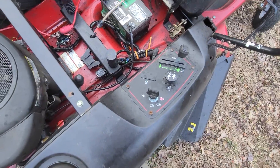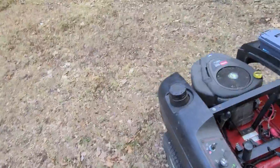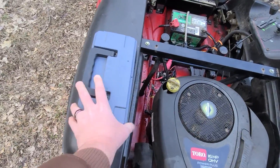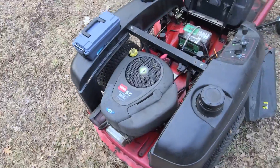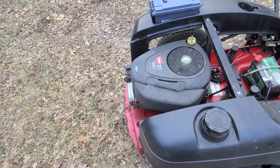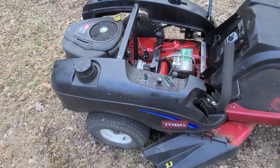So it runs pretty well. The one caveat — and I've never been able to figure it out no matter how many times I've cleaned the carb — is that it is cold-blooded as they come. Initially starting this, if it hasn't been running, is a task. I just keep a can of starting fluid in the storage cubby. Usually takes two or three minutes to get it started, several attempts — choke on, choke off, repeat. But once it starts and runs for a couple minutes, it starts right back up without any issue. I just want the potential future owner to be aware that this thing is a bear to start when it's cold.